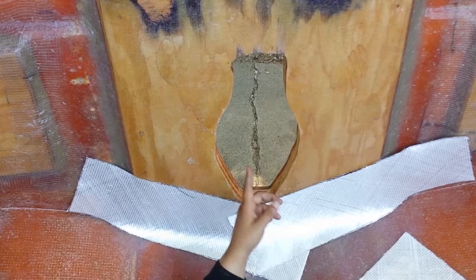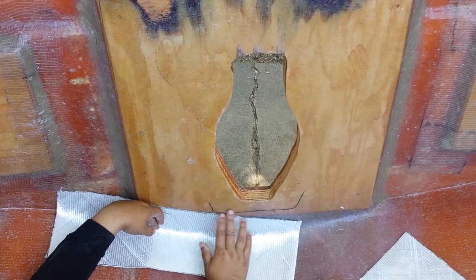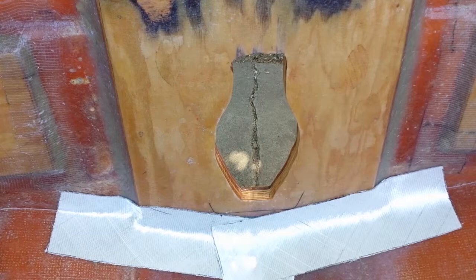So what you have to do is tab underneath wherever that spot is. See? So that you don't alter that thickness. Now, my transom plate, when I put it on, I had to drop it down a little bit because it was a little bit off. So, let me get it and show you. I'm still going to do it like this, and then I should probably trim this to come to about here.